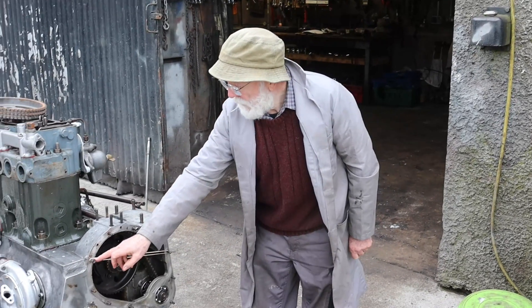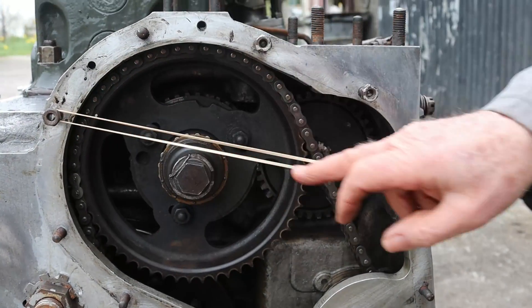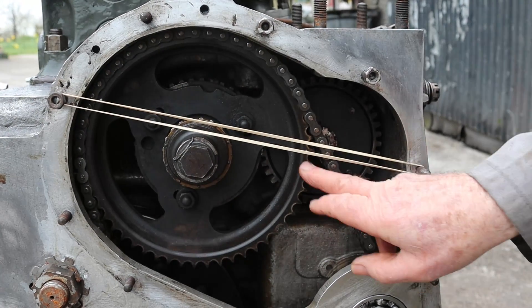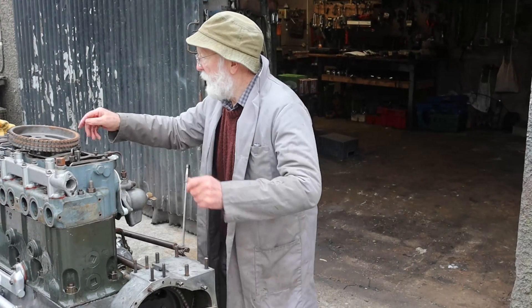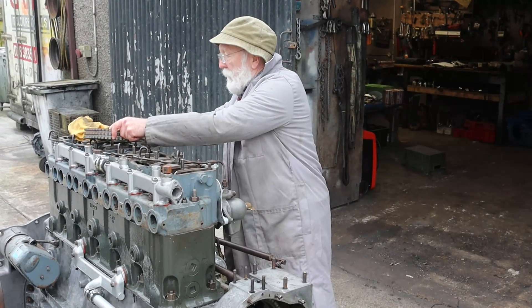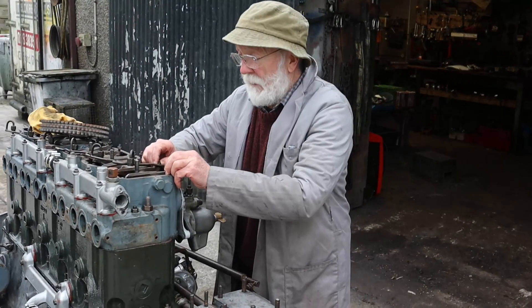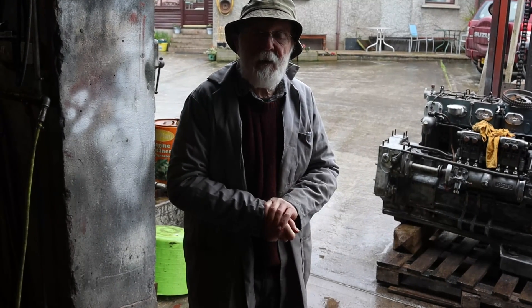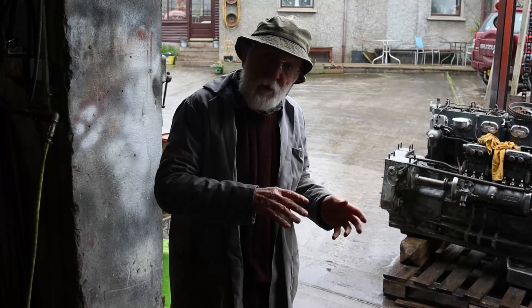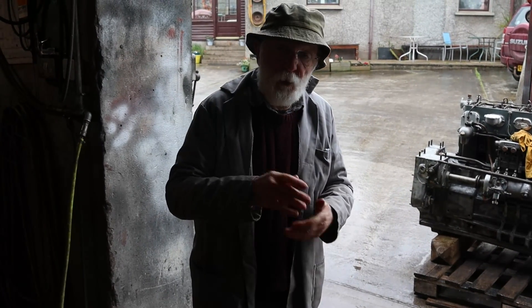Now if you look, you'll see that the two dots are in line — that one and that one. See that mark in there and that mark in there are in line. We now know that the valve timing on the engine is spot on. Another way that we can tell that she's on top dead center is the tappets will be set here on number one. Unfortunately it's starting to rain so I'm afraid we have to abandon this project for the time being. But from what we've shot so far you should be able to see that the valves are now set up spot on — the valve timing is spot on relative to the crankshaft.